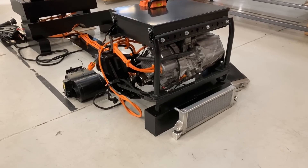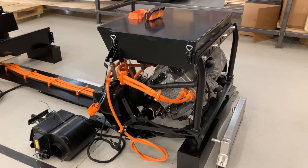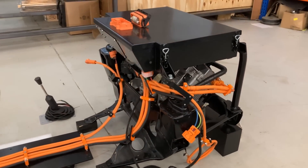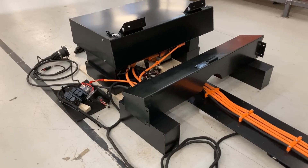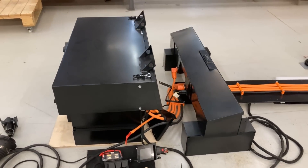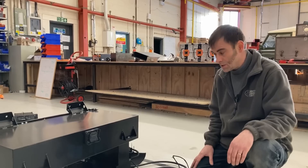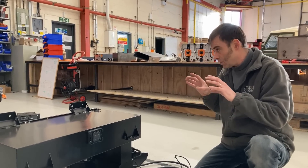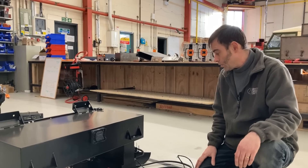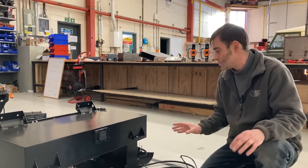There's a seven kilowatt charger that goes on this as well — the charger normally sits in the engine bay at the front. The idea is this can be installed without having to cut into any of the high voltage cables, because it's all already pre-crimped connectors. So this just literally bolts in; there's a couple of holes that you need to drill, but that's it. And that's what I love about the kits we do — it's a real light-touch conversion, you don't have to weld things onto the body or change things too much on the car. So it's completely reversible in that respect as well.